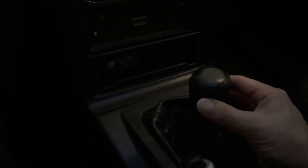So I'm in the Miata and I'm having a problem getting the car to go into gear and stay in gear. What's happening is it'll go into gear, but then the pedal will go all the way to the floor when I try to push it in, and the clutch won't engage. So it'll get stuck in that gear, and I basically have to turn the engine off for it to go back into neutral and pump the clutch a few times to build up pressure. And that could only mean a couple things to look at.